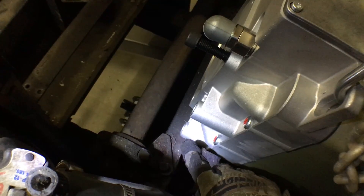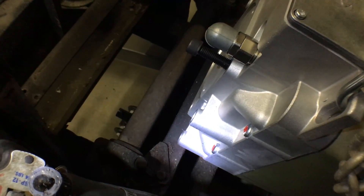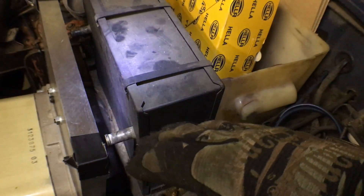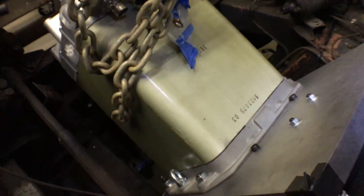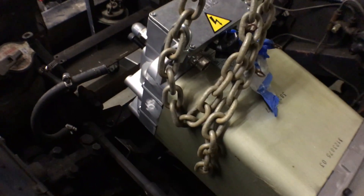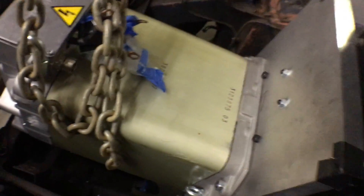We're right in the home stretch. If this could go forward that little amount of distance, it would drop down and this motor would be in — but it's not quite there. So I think the easiest fix is going to be to remove this heater core, cut away some of the car — or maybe bash it in some more — kind of like a little U shape here, and then it would slide right in. And it's looking like those bolt holes on this side are going to line up with that frame almost like this motor was born for it. That'll give us a nice mounting spot, and then we can fabricate something to go from here to here, and yeah, then we'll be done.